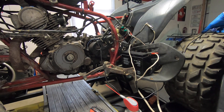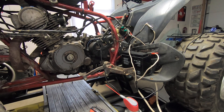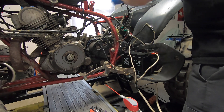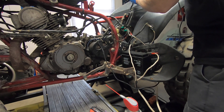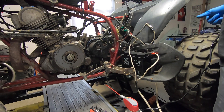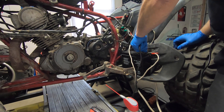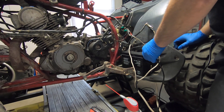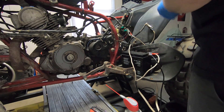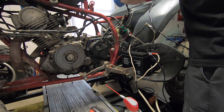There should be some type of safety — it's usually a clutch safety. Let me put a clamp on that. Let's check it now. Nothing. Nothing. Nothing. So one of two things. It's probably the ground, so let's do that — put this on here and check the ground. Power. See if we can get anything out. Nothing. All right, we've got something going on with that CDI. Let's see if we can get anything for crank. We get nothing.